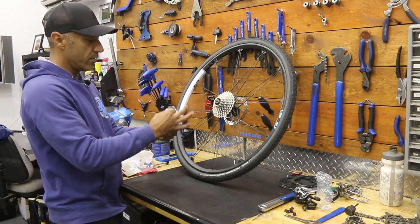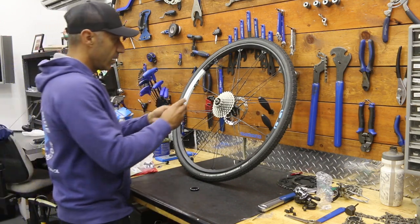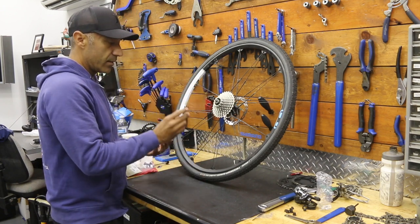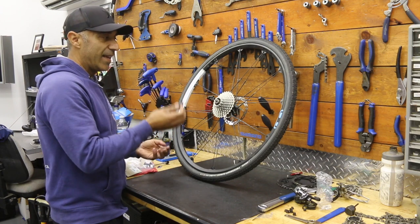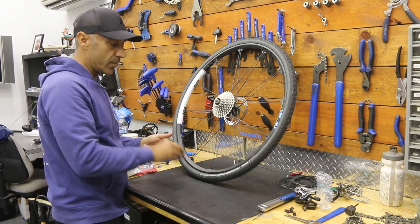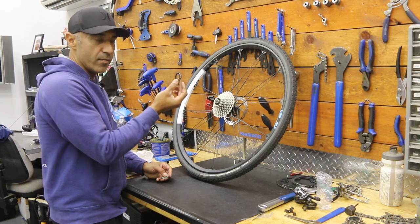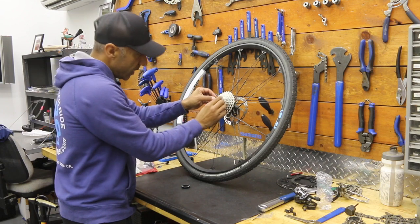That was the first time I did that all in one go. You've got your lock ring and your last gear — just slide that on and make sure the last one sits nice and flat. If it's not sitting flat it may look like it engaged, but when you go to screw your lock ring on it may grab one or two threads then pop and slip, or worse it'll strip the threads. This is an aluminum lock ring so those threads will get messed up first. Make sure this is always nice and flat once you land it.